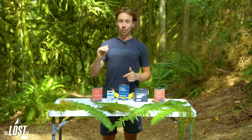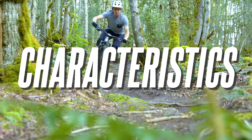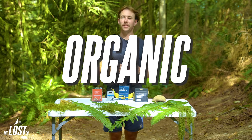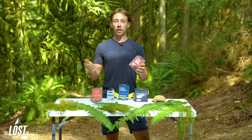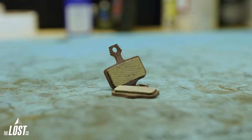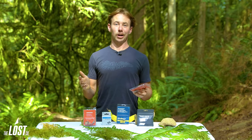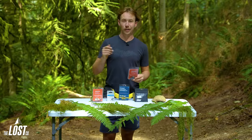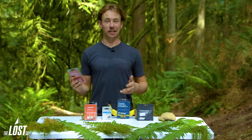Because of the difference in how these pads are made and what's inside them, they perform super differently out on the trail. Out on the trail, organic pads have a very smooth feel at the lever with minimal vibration and feedback coming back to your hands, and they're also one of the quietest compounds. Because they're made of a softer material than other compounds, they'll take the shortest time to bed in, but that also means they won't last as long as other options — and that's especially true in wet conditions. During those wet winter months, with all that water and grit finding its way onto your rotor and pads, you'll go through these organic pads very quickly.